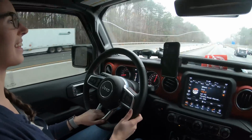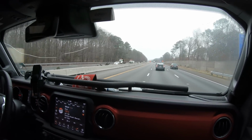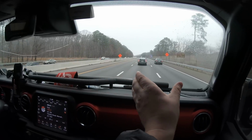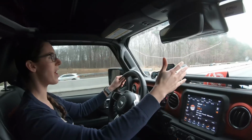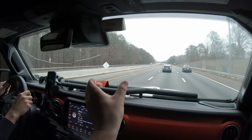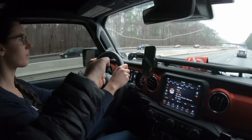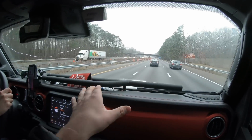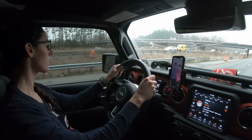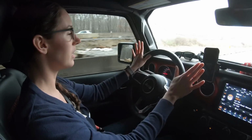So you can tell, normally, and this is 64, it's a very uneven road. What I noticed before, and I don't know if you noticed it as well, is when there was a dip in the road like this, the Jeep would just kind of drift or sway one way or the other the whole time. And I think that was caused by the steering box being able to move. Whenever there was any lateral force being put on the steering, instead of it coming back to the wheel, the box would move and it would just kind of drift around the lane. And that's why there was a dead zone, because that steering box was moving. Right. There's still play, but a tiny bit, but I think that's just Jeep. That's just Jeep.